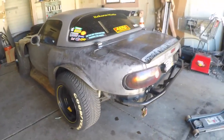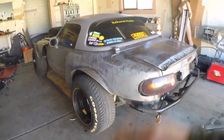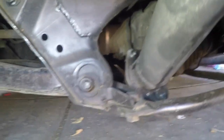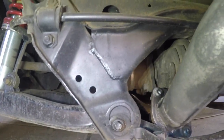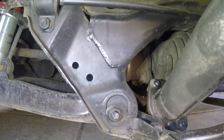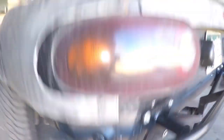You can find them as low as $400 depending on where you find them, but it's usually just the diff. You may need different axles if you're going from a 1.6. The two-piece axle — you can see there right next to the diff — there's actually a flange with nuts and bolts holding the CV axle to an output on the diff. That output pops out just like the one-piece axles do. If you have a 1.8 you may have two-piece axles or one-piece. Either will work on a 1.8 diff, but the 1.6 diff has different splines at the differential, so the axle itself needs to be different.